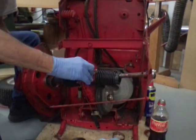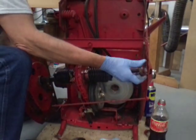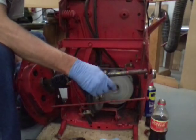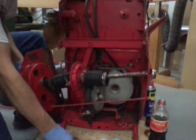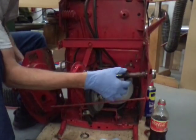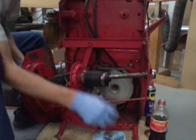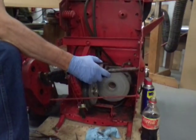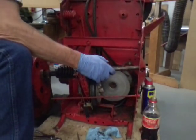Get that clamp back on — just fell off on me. Now we'll get the hexagon thrust washer back inside of the shaft. Looks like originally they had two shims, and I put on three. So for right now we'll put them back in and see if it really needs it or if we have to take some out. Get this thing wiggled back in shape here.